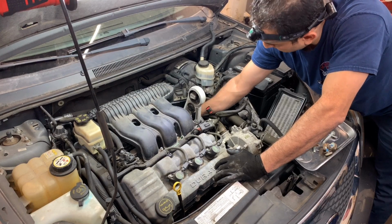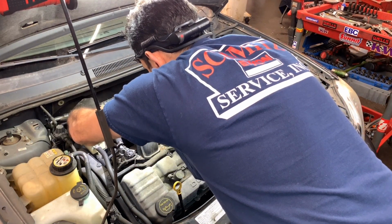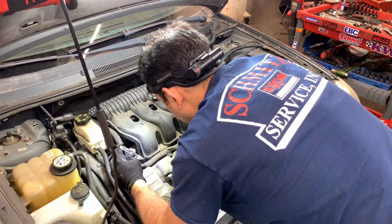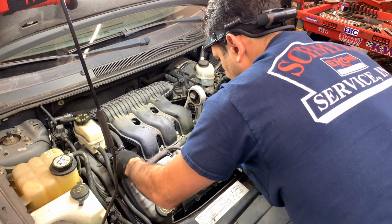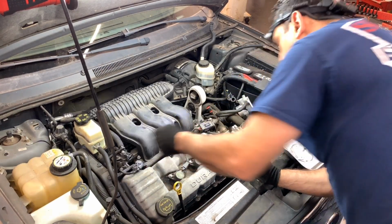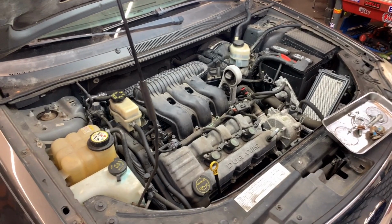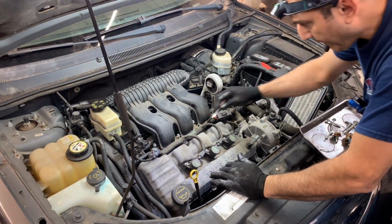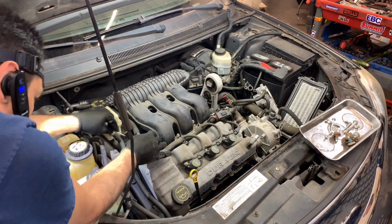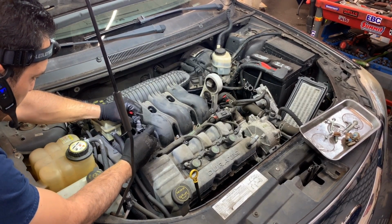All right, that's coming beautifully. All right, got that EGR off, and the intake should just now come off. Oh, we have injectors coming with everything, right? Looks like we are. So we can unplug here. And we're going to need to disconnect this fuel line. Just take your time always. Hopefully you guys are getting a good picture of what I'm doing. I think you got a good angle. And this is just a push. Most likely there's going to be some fuel in there. No, there wasn't.